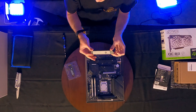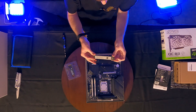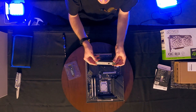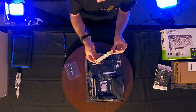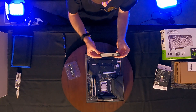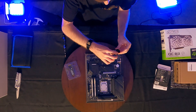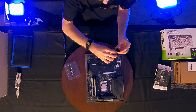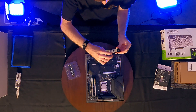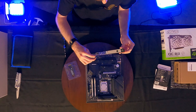This is very, very important: if your SSD doesn't have a thin strip of plastic protecting it on it, then check that cover that you took off earlier. In my instance, the thin protective plastic layer was on my motherboard cover for the SSD, so go ahead and make sure to peel that off because you will burn plastic and potentially ruin your SSD if you don't.